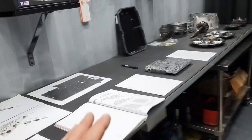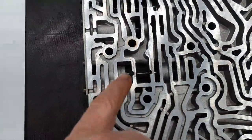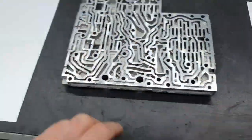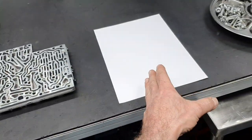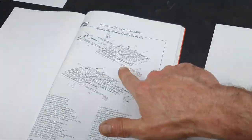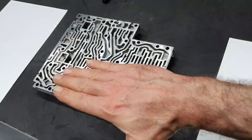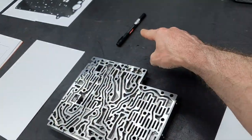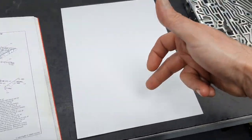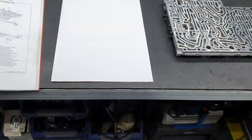Now, first was to be able to remove the solenoids. You see that still wet, the solenoids inside. They're not dry. Okay. A4 sheet on the left, on the right, the book. Now, the valve housing here, see where's the notch, where's the gear selector going inside. Here, it's this way. All right, marker, removing it, placing it here, one by one, and then washing it and bringing it again inside to mount it back again, as it was.